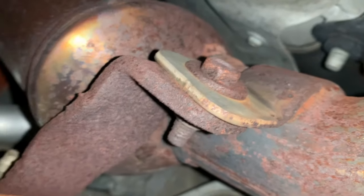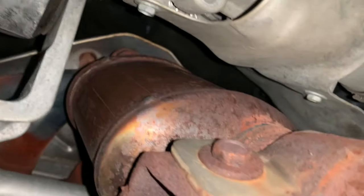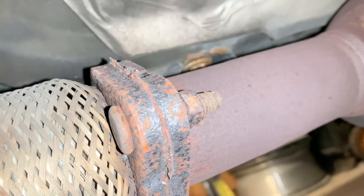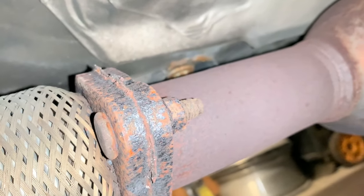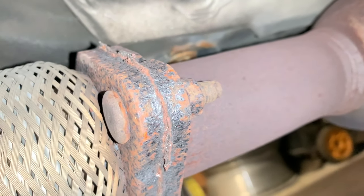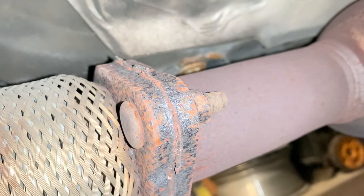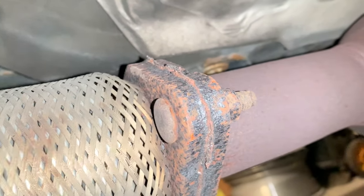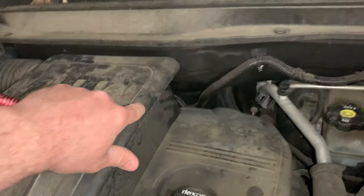Just looking underneath — going to have a mounting bolt that'll need to get loose. The studs to manifold are up there. You can get a better look at that heat shield — that's going to have to come off. It runs down here and there are some mounting studs. Really, it doesn't even matter if they break off because the new unit's got new studs on it anyway; it'd just be a matter of getting some new nuts. Going to get some PB Blaster on all these.